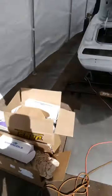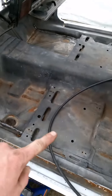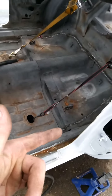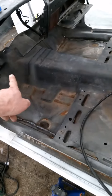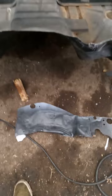Finally got a bunch of parts in for the Camaro — now starting to finish up welding the rest of the floor pans. Got to get those mocked up and chopped up. We're using 2015 seats, so I might not be using the stock ones. I also need to get underneath and weld in the double layer, and I've got to reshape the transmission tunnel because it's getting a six-speed automatic out of the 2015.